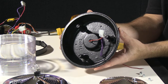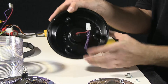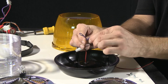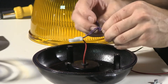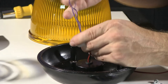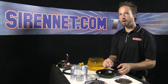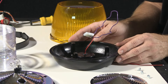You can see here the cast base of the S360, with a center-mounted grommet for the pigtail wiring to run into. If you're curious what the purple wire is here, it's the unit's high-low function. If you take this wire, snip it, reroute it through the unit's base, and connect it to a switch, that will allow you to adjust the intensity of your beacon when it flashes — a high-low or day-night use, as it's often called.